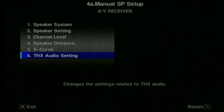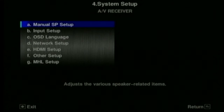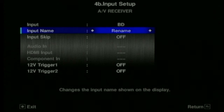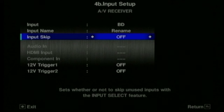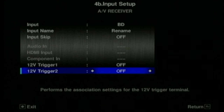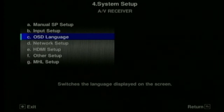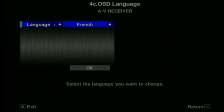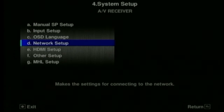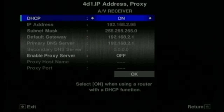That's the great thing about this and most of the AV receivers on the market - you can get it out of the box, start using it and it'll sound great, but then you can tweak it and see what sounds better. Here's where you set up each input - you can set it to skip, which means when you use the dial on the front to go up and down the inputs it won't appear, so if you're not using an input that's quite handy. You can set the 12V triggers at the back to come on and off, which is useful if you're using a projector - certain inputs can make a projection screen come down and others won't.